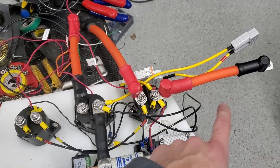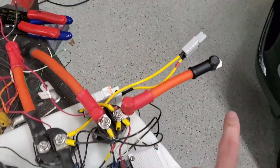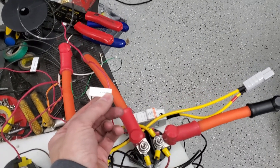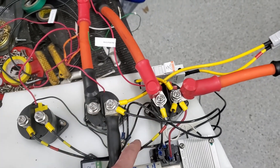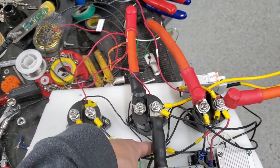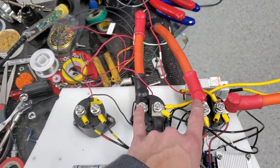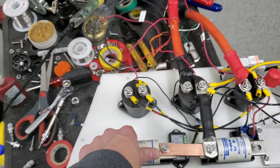On the positive, I'm going to have the two packs meet together with a switch. When it comes back in it'll be one cable going to here. The Tesla controller also controls this one — pin G. The negative of this one is back here with all the grounds. The controller will open this, it goes through the relay here, through the pre-charge resistor, and finally gets things open. These two will go to the motor, and this one is for the DC to DC converter.